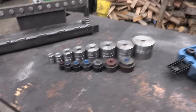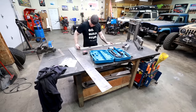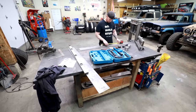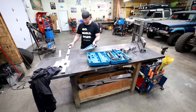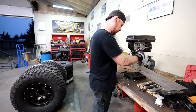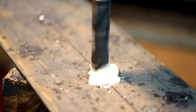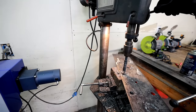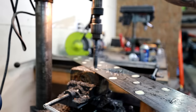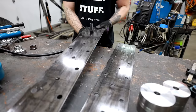It's going to be really nice to not have to deal with all the dust and debris associated with hole saws. The first thing I need to do is lay out the webbing in a way that looks aesthetically pleasing — this is something I can't help you with, there's definitely more than one way to build a slider. The style I'm into right now is a bunch of half holes on a piece of webbing that is wider than what we need. This is a six inch wide piece and we only need four inches, then I'm going to be cutting a bunch of those holes down the middle with the plasma cutter.